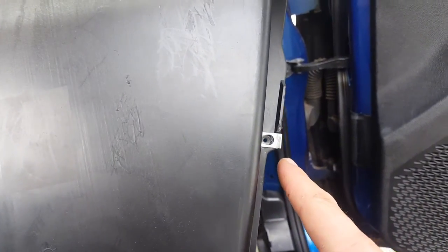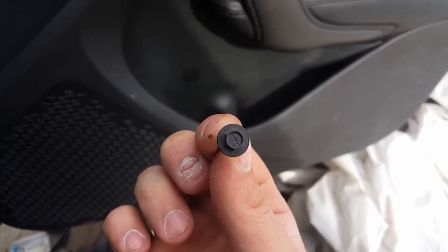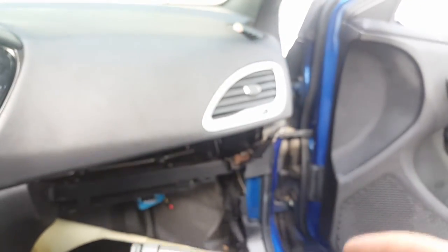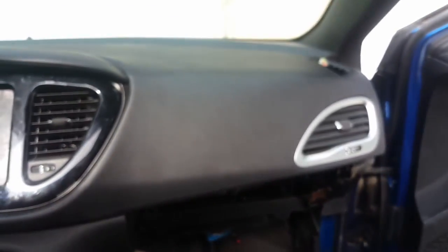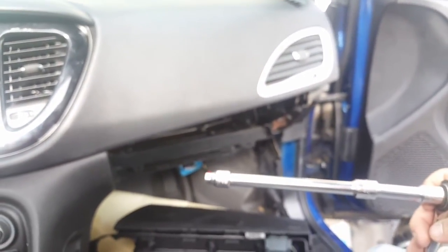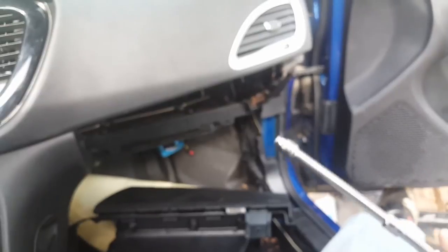Those are the ones you're going to be taking out. As I showed you, this is the bolt you're going to have to take out — seven millimeter. You're going to need a long socket setup. I had a short one and then a long one — about eight to ten inches long. Either way, you're going to have to have a long setup in order to get in there.